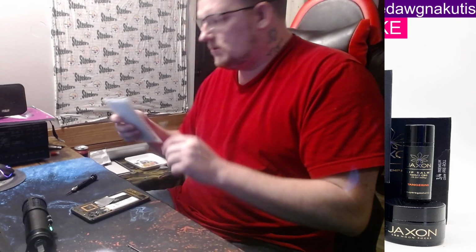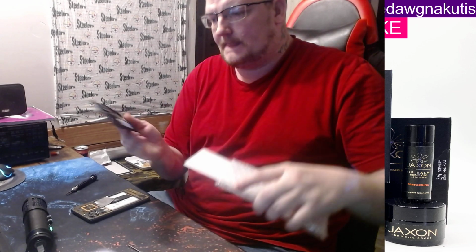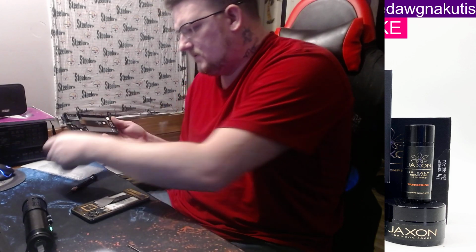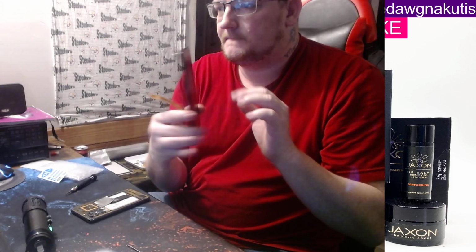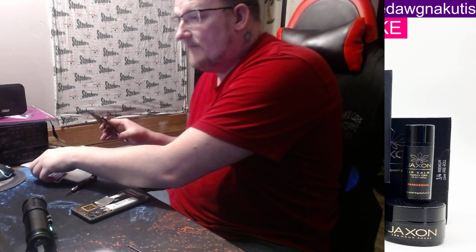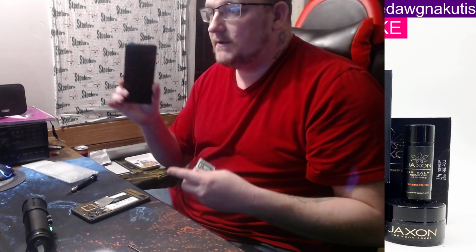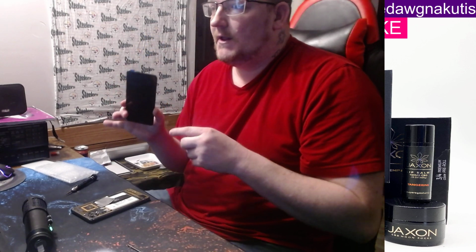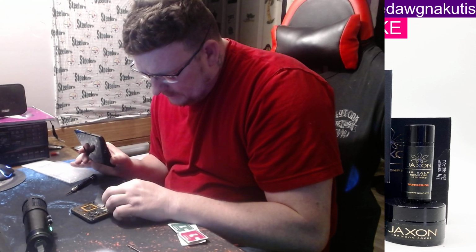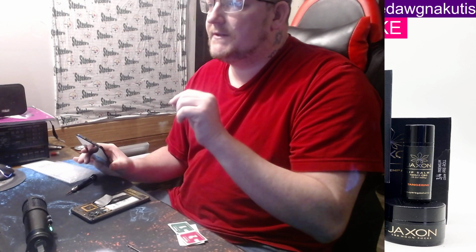Got the new screen right here. Got the new stuff. A new screen. Amazon. If y'all have an A32, Samsung A32, and your screen's cracked, they got good deals on Amazon. But make sure you get the A326U and not the 326B.